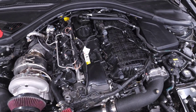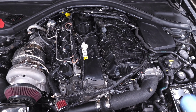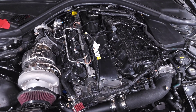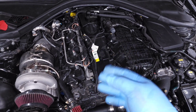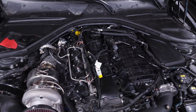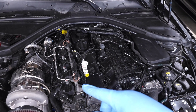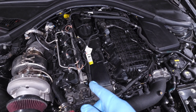The next thing you want to do is turn on your car without actually turning it all the way on — basically get the engine to crank over and over without the engine starting. The easiest way to do that is to disconnect your fuel system. Some people like to do it by unplugging the coil packs, but that's still going to let fuel get into your cylinder which is not ideal — you don't want fuel spraying in there without it burning off. Also, unplugging the high pressure fuel pump or disconnecting the fuse for the low pressure fuel pump won't stop the engine from turning on because there's still fuel in all the lines going to the injectors.